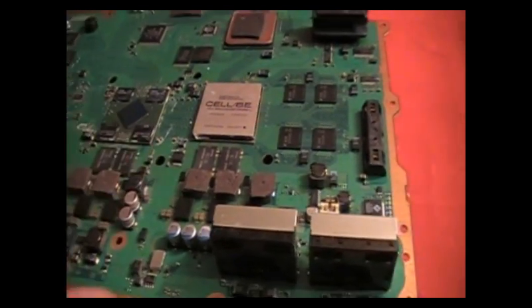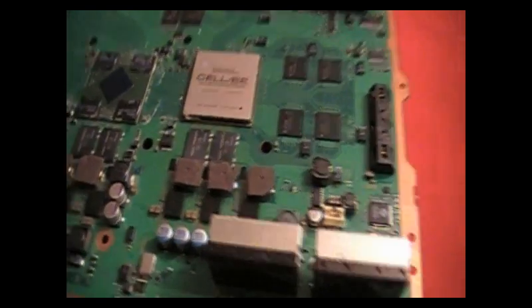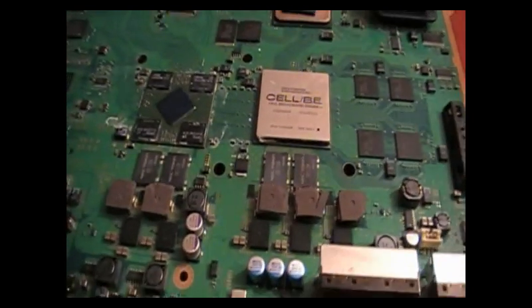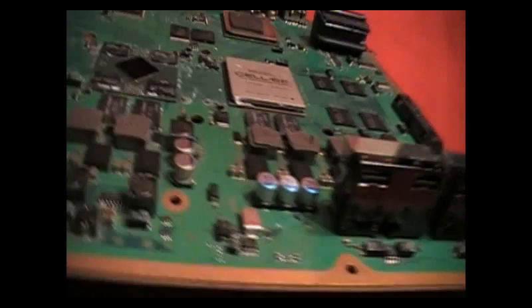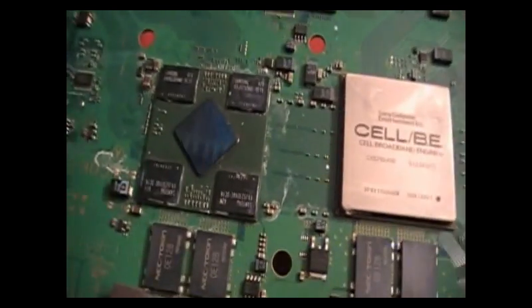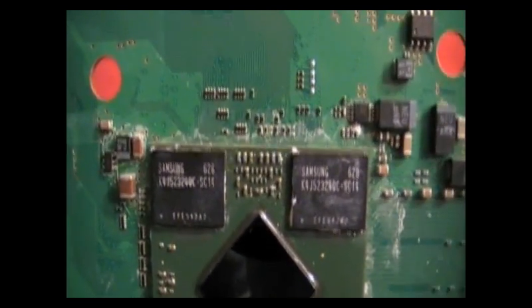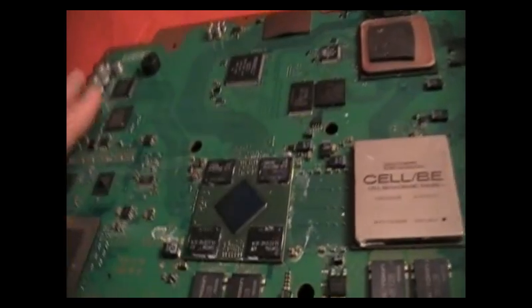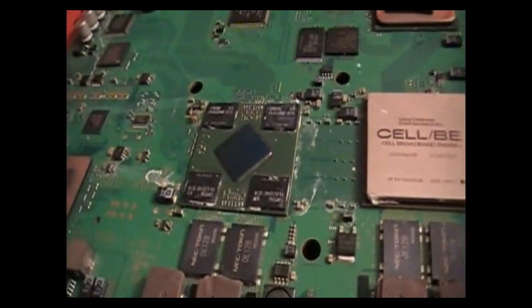There are some fat models out there but the fat just doesn't do well — it overheats so easily. People put them in cabinets and don't clean them out. They get dusty. It's just not something you want to see. This is a huge board and a massive, bad, flawed design. The person that did this reflow — he told me he had it reballed, but I guarantee this wasn't reballed. This is a total reflow job. They were sticking the flux underneath and squirting it underneath. They probably used Kester — you get Kester with the kits on eBay.